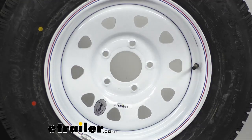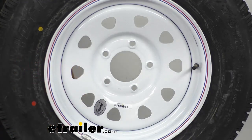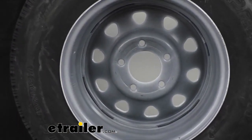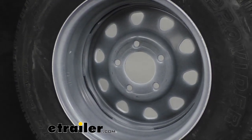It's got a nice steel wheel with a 10-spoke design. Those triangles there are the spokes, and there are 10 of them, so it's a 10-spoke. They have a very nice three-step finish process that makes for a smooth, nice white, bright color. It's a phosphate zinc bath, then an e-coat primer, and then they finish it with a white powder coat on the outboard side. On the inside, they do a light e-coat to reduce friction and provide rust resistance with less flaking.